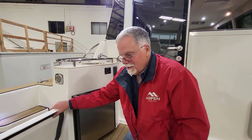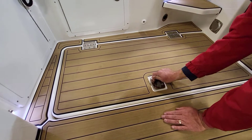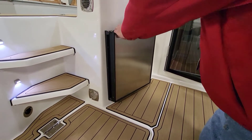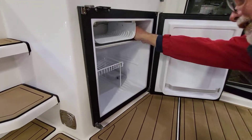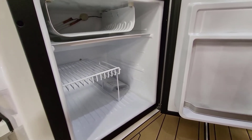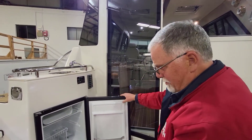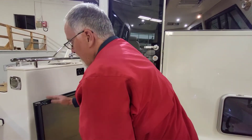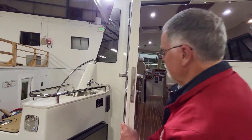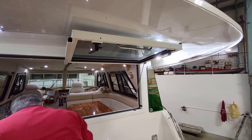These are stainless steel gas springs — not powder-coated automotive parts. For the refrigerator, to control the temperature, open the latch and use the control knob. Four is about your normal refrigerator setting. If you want to use it as a freezer, go up to about six or seven. Keep in mind that as a freezer it draws about twice as much power. The door on this one is about three inches wider than on a C100, and this hatch is also about five inches wider.